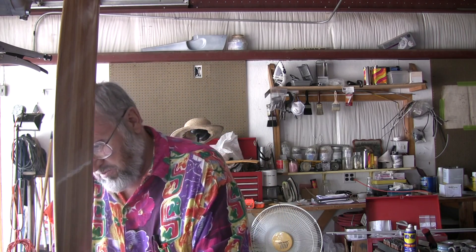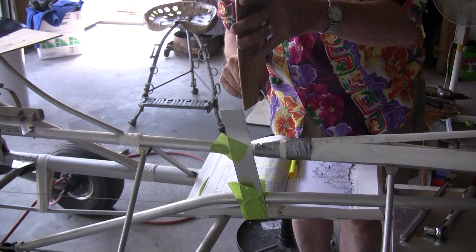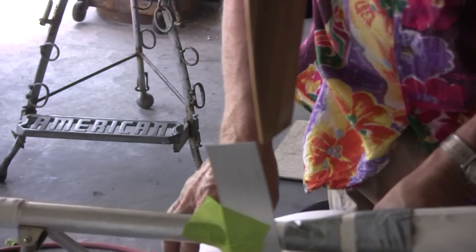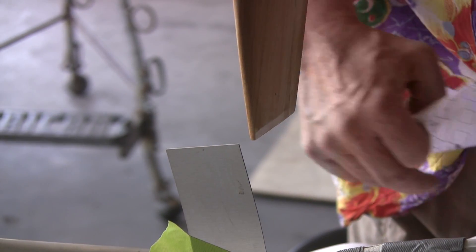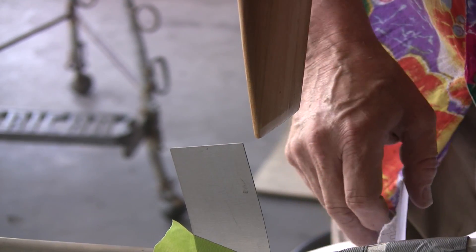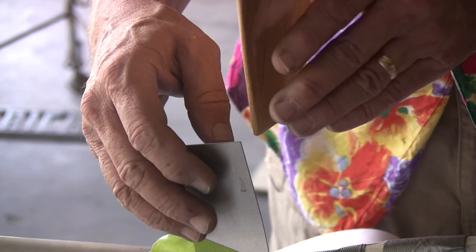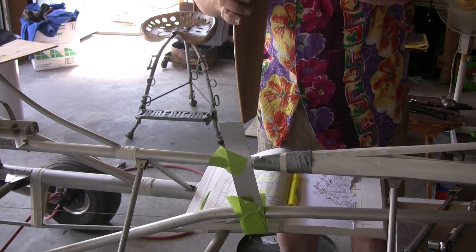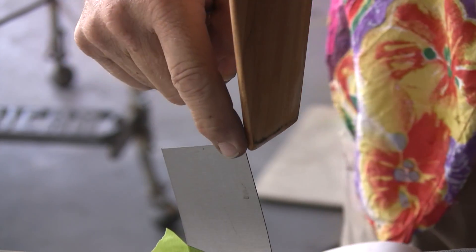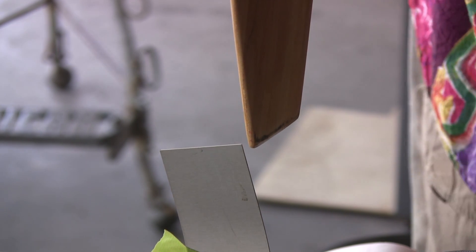I'll show you — if you want to zoom in here — I've taken and taped a piece of aluminum to the side of the tubing. We're allowed up to 1/16th of an inch. If you go into AC 43.13 section 8-42, it shows propeller tracking as being 1/16th of an inch. I've actually preset this to shorten the video. As I pull this propeller through to the opposite blade, we look and we have the same distance from my mark to the tip — the forward leading edge of that prop — and that's telling me our tracking is in place.